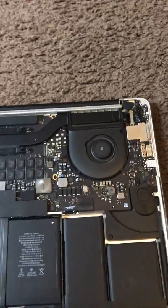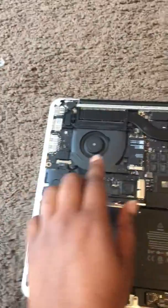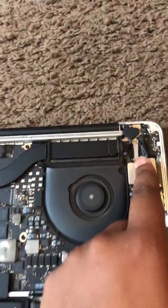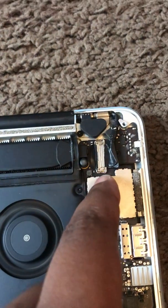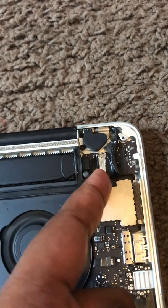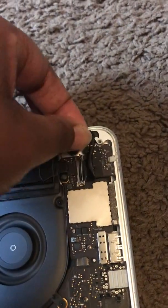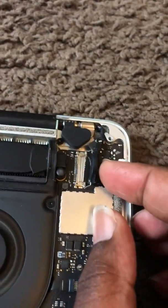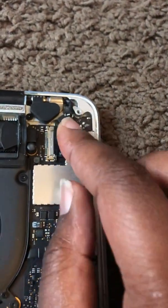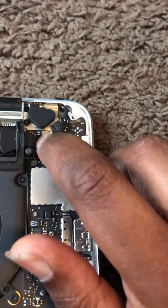For the person that asked me how I did that: when you take the back panel off, it's over here in the right-hand corner up top. This is the display cable right here. The only thing you have to do is lift this bracket up and push this part in, making sure it's snug in there, then push the bracket back down.